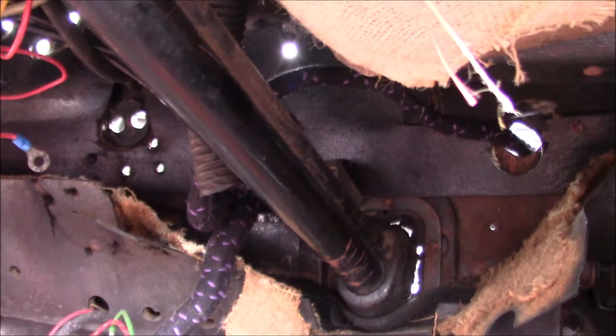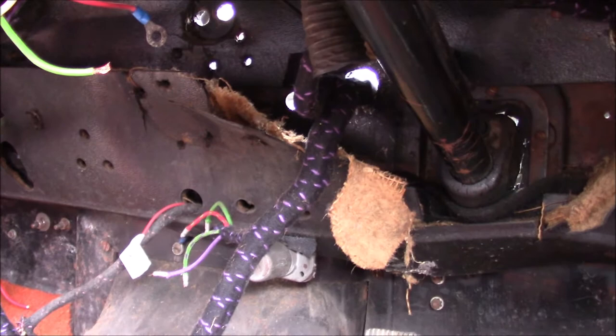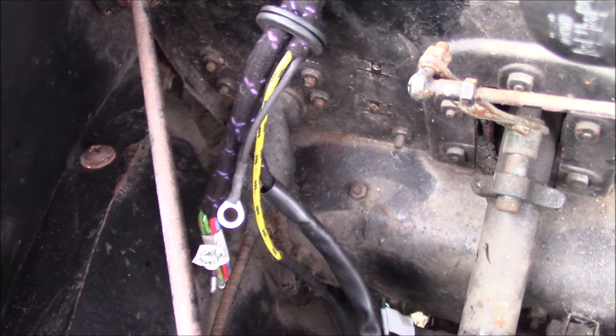We've finally figured out the wiring route, and it's a nightmare. Every car I've looked at, and every Lanchester I've looked at, the wiring's different in the engine bay, and I haven't seen one with original wiring intact, presumably because it's all degraded. So there's not a lot to go off. In the engine bay, instead of all the wiring that went to the dashboard coming out through this hole, this one is now the main branch for the bit that goes down the chassis — it's the generator and the starter motor on this side.